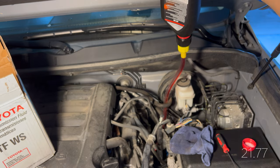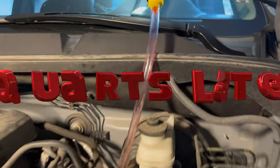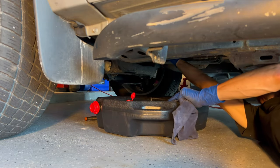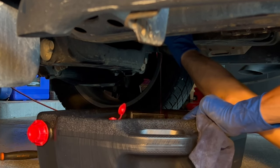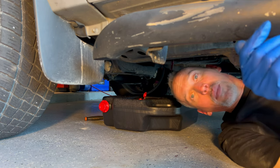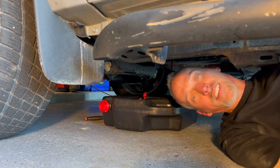That's a whole quart — done. I've tilted the tube up so we can get all of it drained into the transmission and it'll clean up for us. I still have my drain pan here. I think I got a little too excited putting the entire case of fluid in — we probably only needed five quarts, because fluid is starting to come out of the fill hole right now, and that's not supposed to happen.